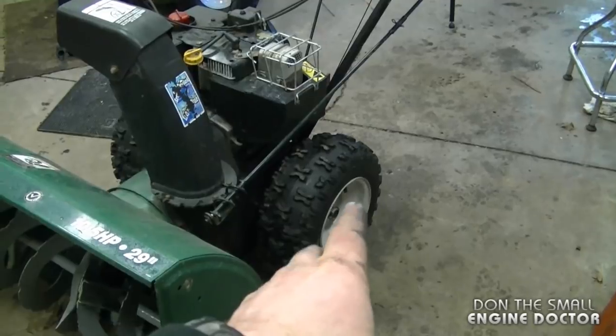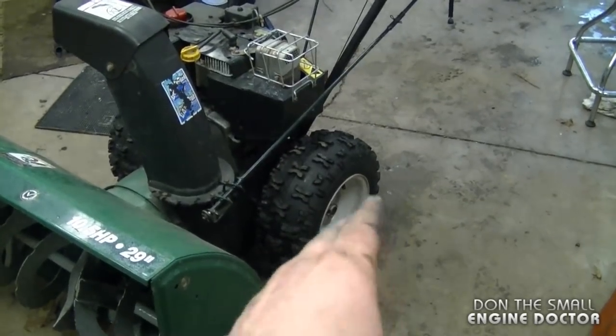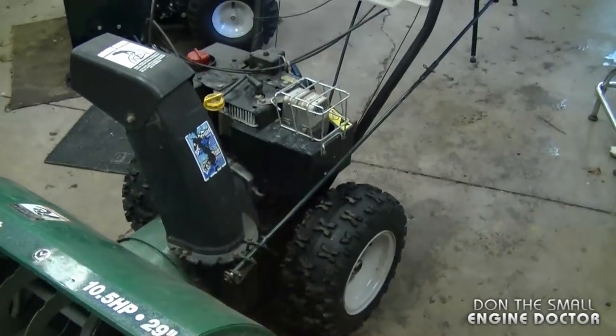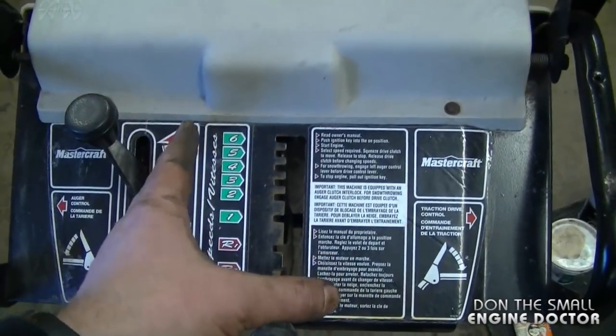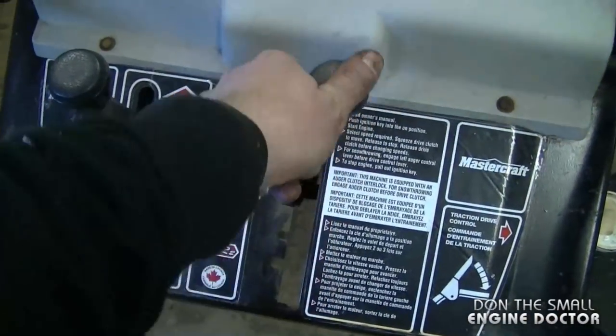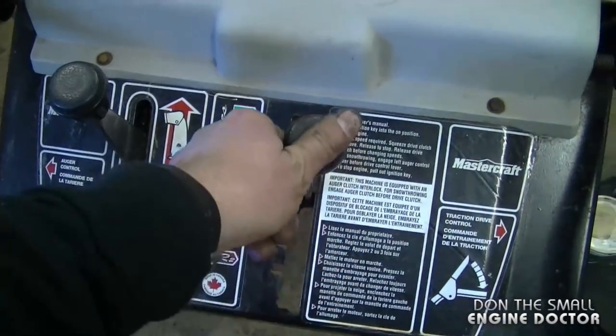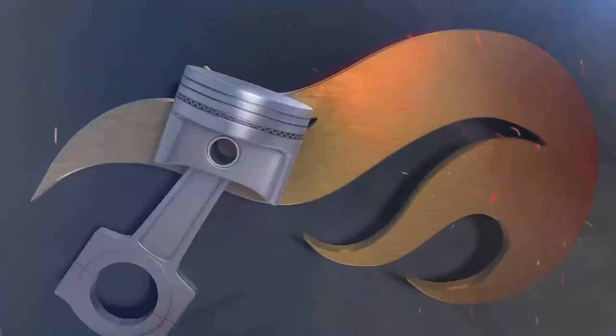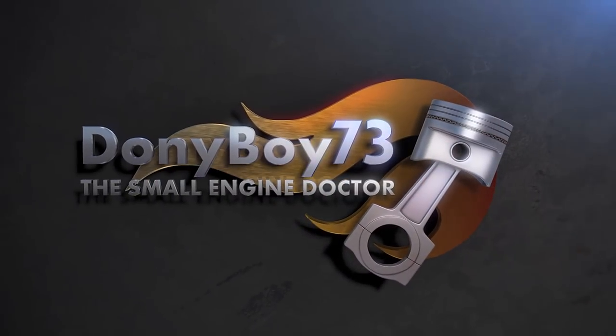By doing this maintenance you're going to prevent a lot of wear and tear on your critical parts. Putting grease on the shaft so that the wheels come off easier next time is a big bonus — you'll be very happy next time you work on your snowblower. Also, greasing the shaft that the drive disc slides on will make it a lot easier to shift your gears; sometimes the old grease gets sticky and it's very hard to shift. The best part of it all is that your machine will last a lot longer if you do this every year. Thanks for watching guys — make sure to subscribe and I'll see you in my next video. Have a great day, bye!